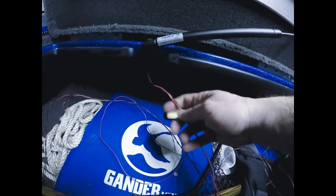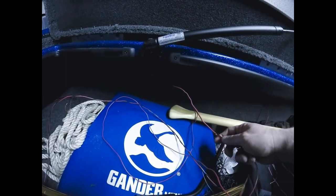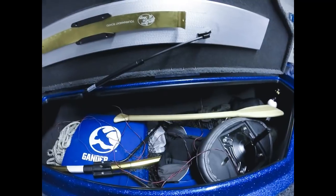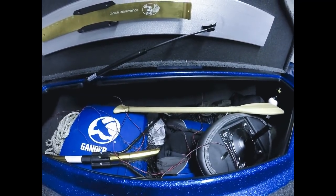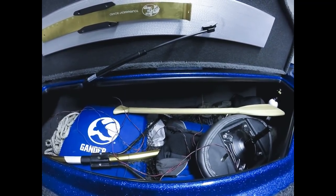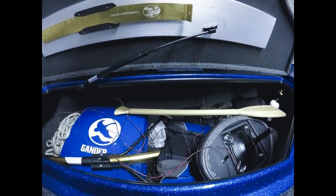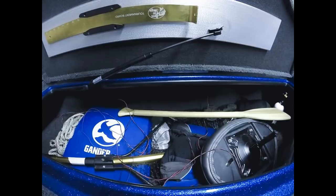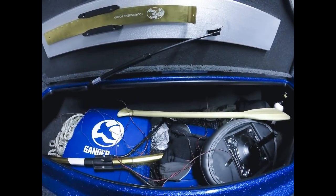These wires right here hanging down from the 12-inch strip in the middle on the driver's side, and then down to the 20-inch strip. And then from there we'll be going into the dash where the dimmer switch is going to be, and we'll connect. I'll show you how to connect that and get that to the battery. So that's all there is to it. Really, again, not hard. Use those butt connectors.